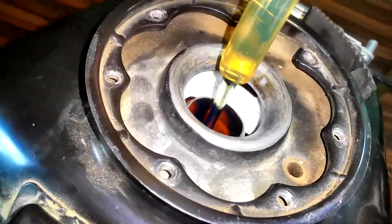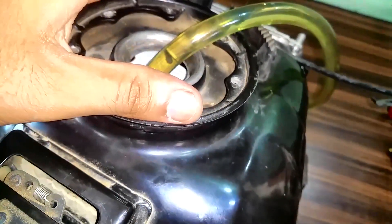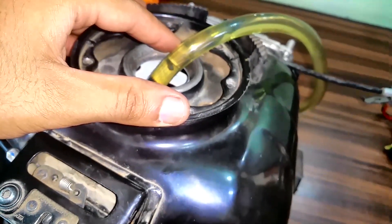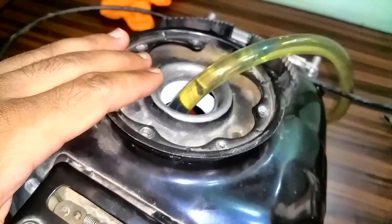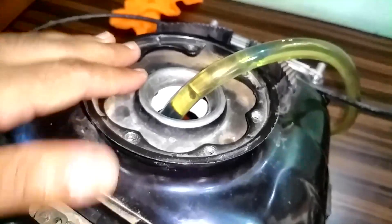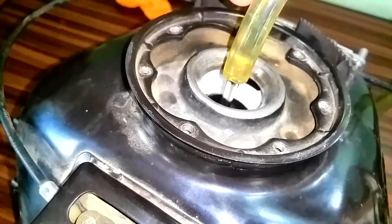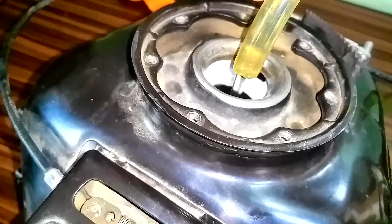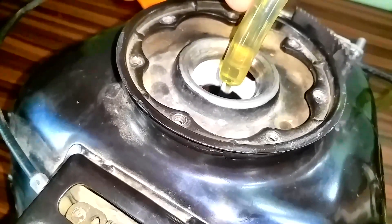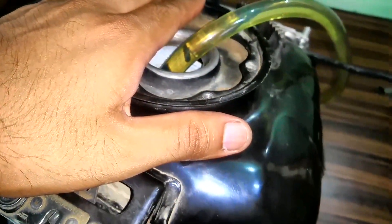You can see fuel going right inside. You might want to run it for five to ten minutes for your own satisfaction. What we're looking for is any abnormalities in sound, or if the fuel pump is missing, or if we're getting bubbles inside the tube. Bubbles mean there's a leakage in your fuel line and air is getting into the fuel pump somehow — we don't want that. Also listen to the noise continuously — it shouldn't shut down at any point, because if it turns off, your vehicle is going to miss as well. That's how you check internal fuel pumps.